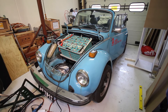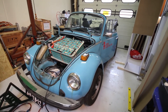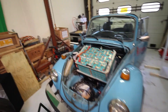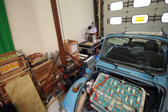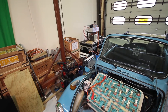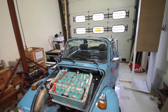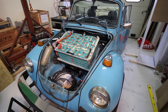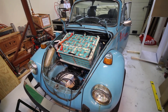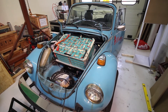She's back. It's the e-beetle and her aging GBS high-power pack is coming out. Over in the back yonder we have three module banks of Better Place cells that will be going in — two in the front, one in the back. Higher voltage, but we love that Soliton. It can go up to 350 charge voltage, and that'll be about 42 to 43 modules. Let's see how we do it.